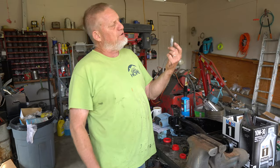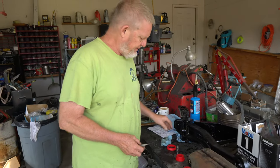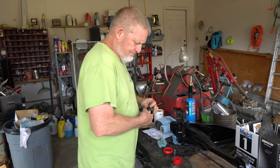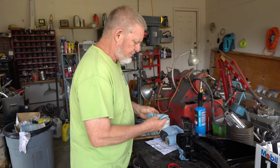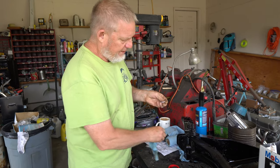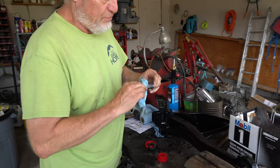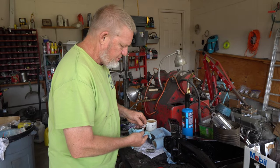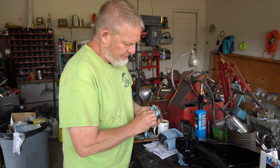The silicone grease they supply — we'll be applying that to this bushing and then assembling it together and putting it into the control arm. I just use a rag so I don't get all messy, pull that baby open, and apply some of the grease there. You don't want any squeaks. I hate driving a pickup down the road where every time you hit a bump you get a squeak. This will keep it from squeaking, which will make it a much better ride.